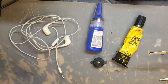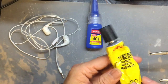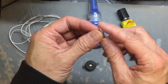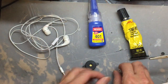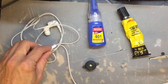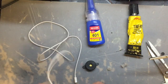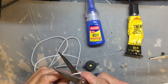Here's what you need to make your own crystal earbuds: an instant dry strong glue, a softer glue that can dry in a day, a piezoelectric buzzer with a hole in the middle, tubes from a hearing aid earbud that you can buy — I'll give you the link — and a damaged smartphone earphone so we can cut off one end and reuse the cable. If you don't have a damaged smartphone earbud, just purchase the jacks and cable and make your own.